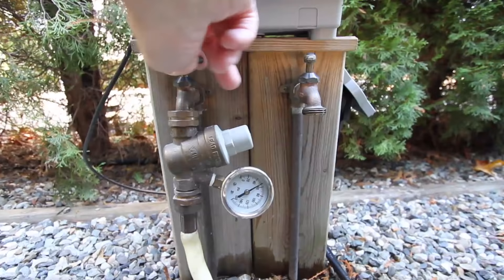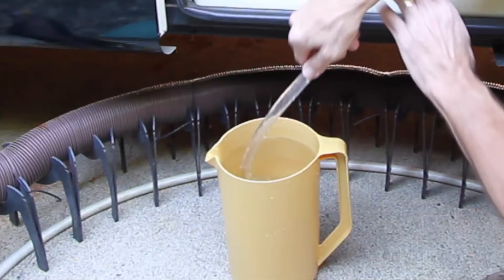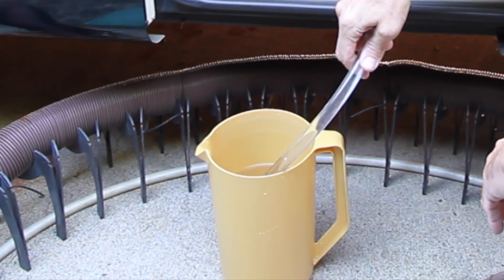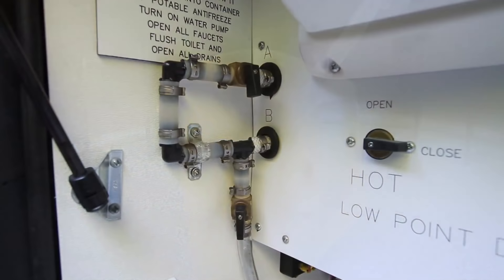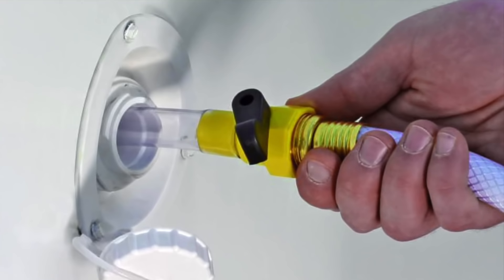Make sure that you're disconnected from the water hookup, or at least that it's turned off, and turn your freshwater tank fill to the on position. Now flip both valves on your winterizing kit, which will open the plastic intake tube. Place the end of the tube into the pitcher and turn on your RV's water pump. This will draw the bleach solution into the RV, pumping it into the only available void — the freshwater tank. Be careful when handling bleach; you may want to wear eye protection and gloves. When the pitcher is empty, turn off the water pump. After drawing in all of the bleach solution, rinse out the winterizing tube by drawing in another pitcher full of clean fresh water. Now switch the two valves on the winterizing kit back to the normal position. If your RV isn't equipped with a winterizing kit, you may have a water fill that allows you to pour the bleach solution directly into the tank using a funnel.